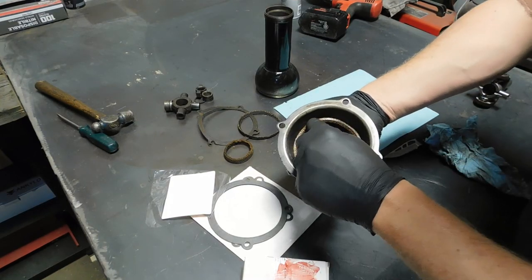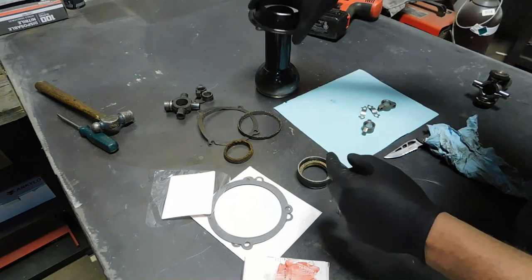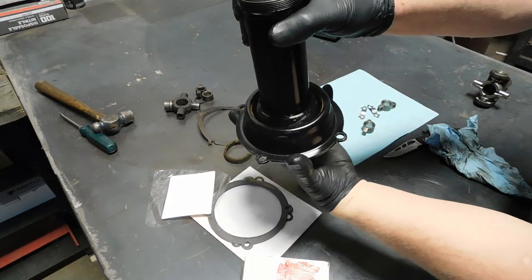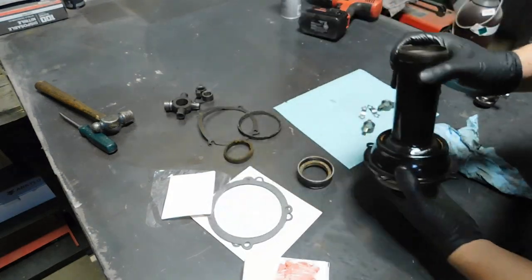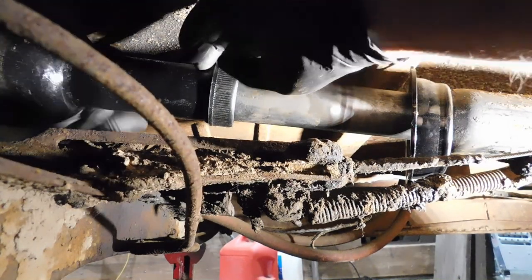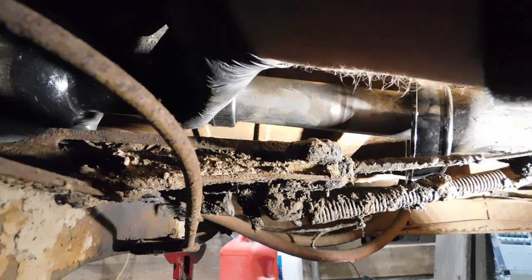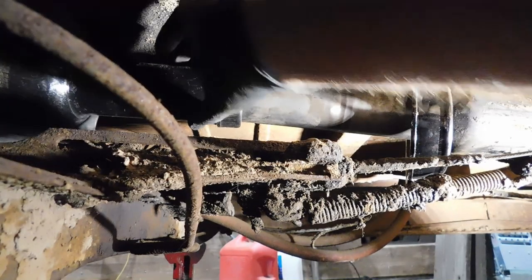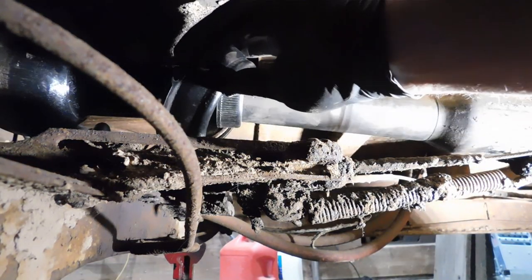Okay, I'll just seat that down inside the flange. Put her down on there. Can see how that's gonna work. Put the gasket in the cap. Put the spacer in, screw it lightly together, and then push out with all your might onto the tube. And go like this, working it around the edge. And have the flange on already.